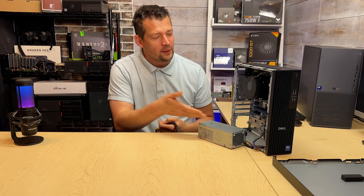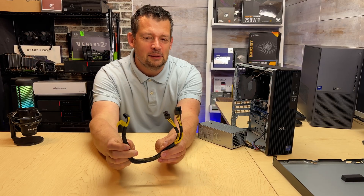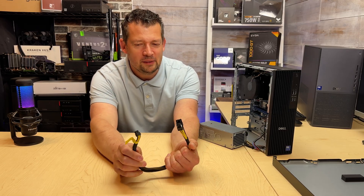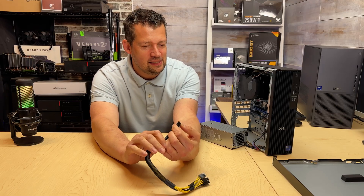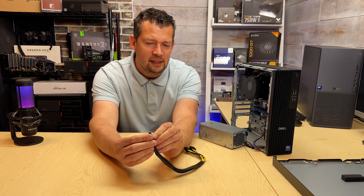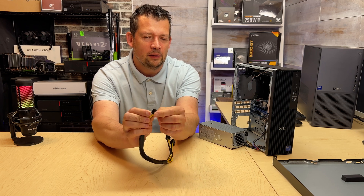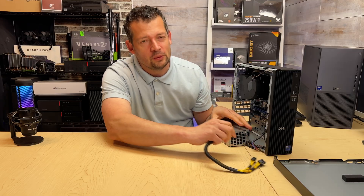I ended up ordering a cable before I actually received this from Dell. And look at this 8-pin — it's a Dell PowerEdge server cable for some sort of RTX card, but this 8-pin does not fit. It's the same size, but as you can see, it's only divided at the middle, while every single section should be divided individually on the back side.